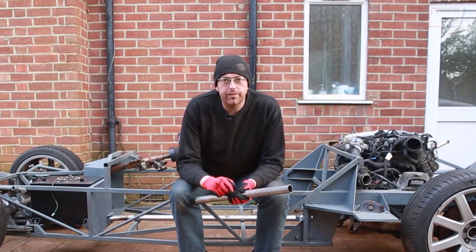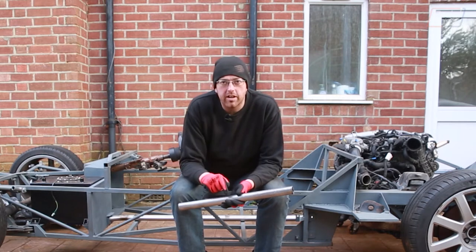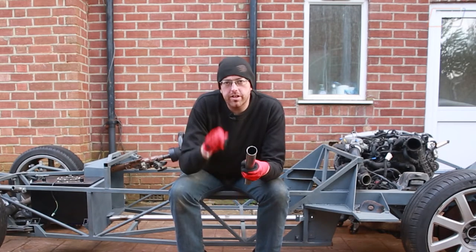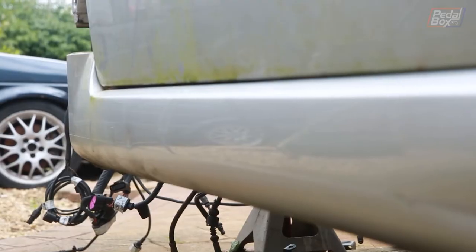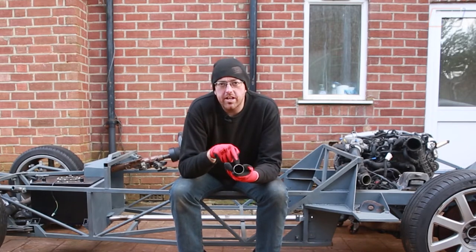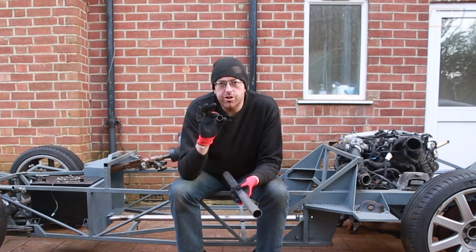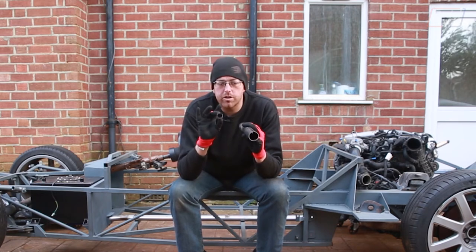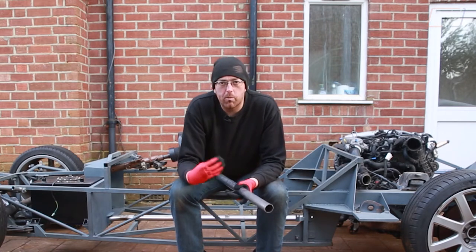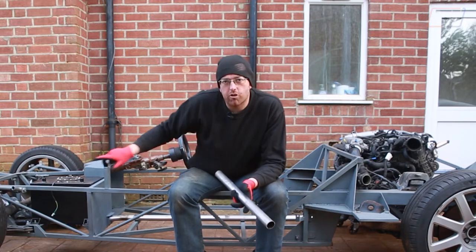Let's have a look at how we're going to build this floor. I've been working out how to do the sill or the rocker panel around the edges of the car, and I've wondered about using something like this — either two inch or one and a half inch tube. This will give us a nice wide radius around the bottom of the car. However, using something this size adds a huge amount of weight to the very edge of the car. Instead, we're going to use one inch tube — still two mil wall thickness — but this represents about a 40% weight saving over the one and a half inch stock. Less weight right on the edge of the car is going to be more beneficial later on.